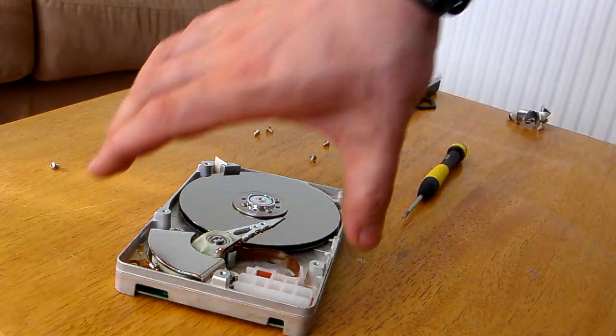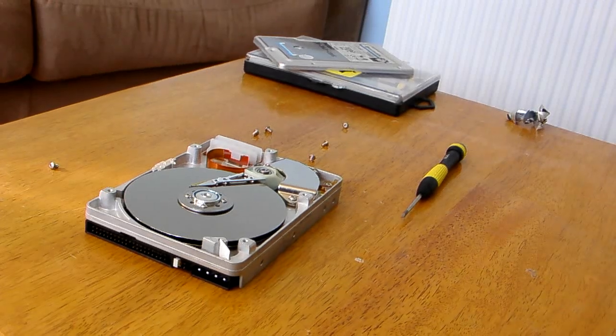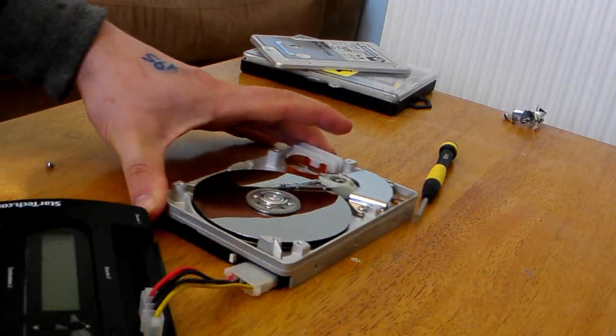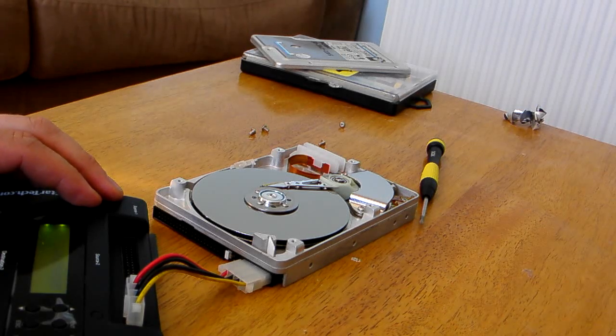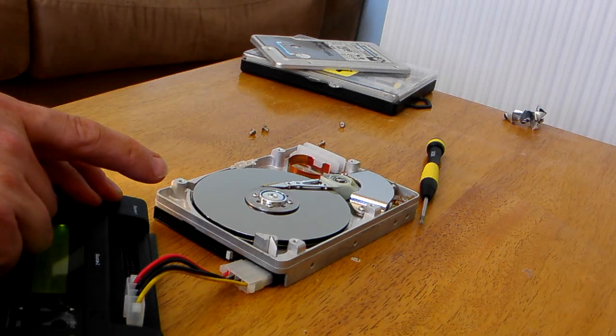So, what we'll do now is plug this baby in and see if she's still running. We might be able to see a bit of head action. Now the excitement's mounting up. Oh, look at that now, isn't that lovely? That's what the hard drive is actually doing on the inside. That hard drive was still working — the hard drive would still read. The problem is, of course, that you've now destroyed the hard drive by taking the cover off, because you're never going to prevent dust from landing on it. And you can see now it's just shut down — it made a few attempts to start up and was unable to do so.